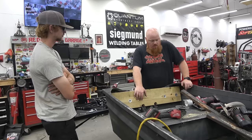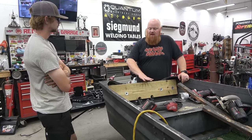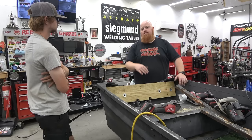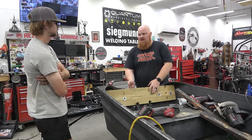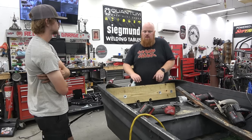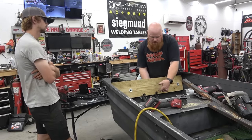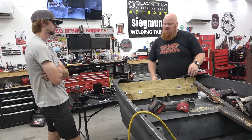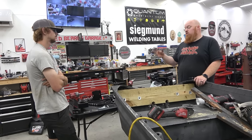I'm leaving. So what we have to do before doing the bolt is we got to put an aluminum cap on this. We might take some diamond plate and bend it in a brake and then cap it off and then TIG weld the back seam. And then we'll make a sleeve that's that deep or so on both sides. Make it even. So we got to do that and then we can put the kit together. We're going to show you step by step how to do the kit.